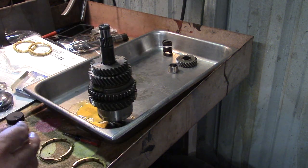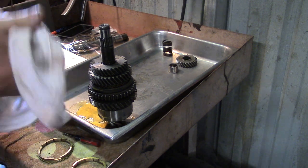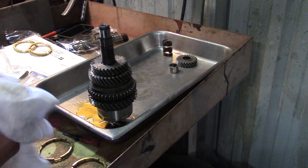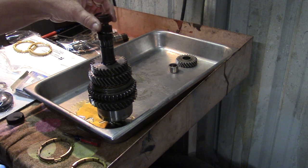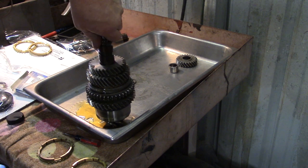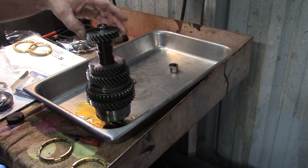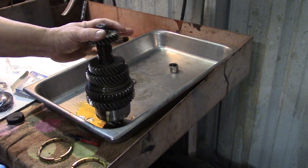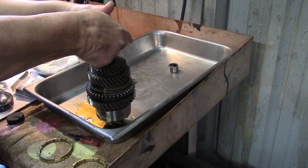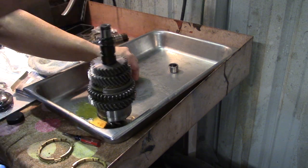So there we go — that's our shaft there. We'll get a snap ring out next. Snap ring the third gear down, then we'll put the fourth gear spring on. That's this thing — that's what loads this. That will go here after the snap ring, like so. And then this gear will go like this. We'll take it over to the press, press that down, put the snap ring on the top and the race on it, and this shaft will be ready to go.